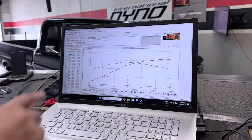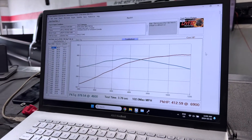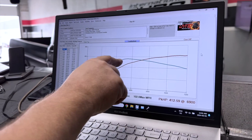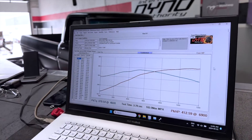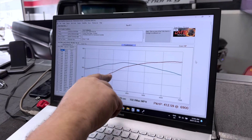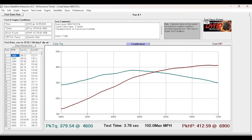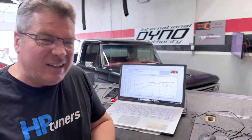Wally has made a series of passes at very low RPM to fix up the bottom end and is now working through the entire range. Eight passes in, we're starting at 300 foot-pounds and pulling all the way through. The horsepower now comes up from 4,000 RPM all the way through, making 412 horsepower and 379 foot-pounds of torque at the wheels.